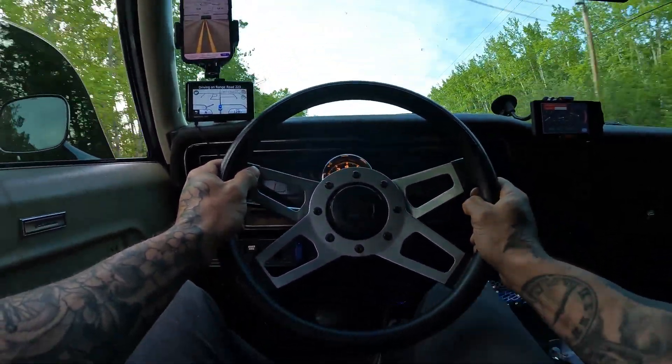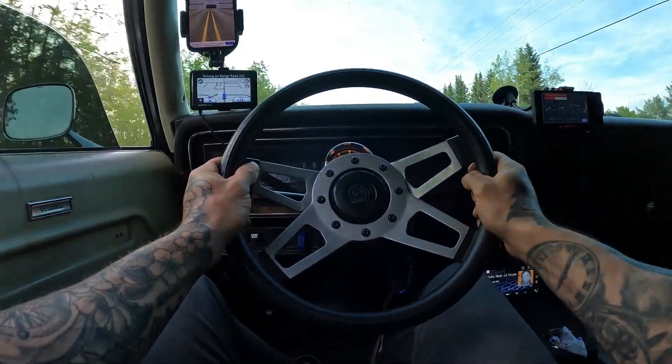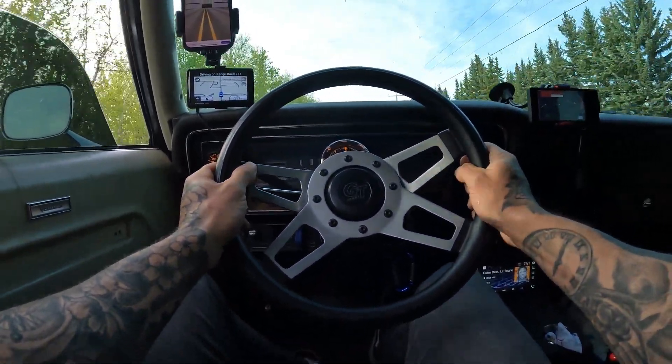I lifted on that one, she was getting the road kind of squirrely. That's 12 seconds with a lift. Made it back home, and that's always a good result at the end of a few hard pulls. That's the hardest I've ever driven this car since the turbo install. Oil pressure was still good, still at 40-ish hot, and I did like three or four back-to-back hot laps.